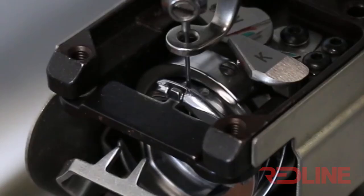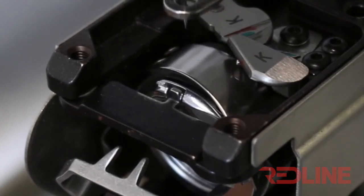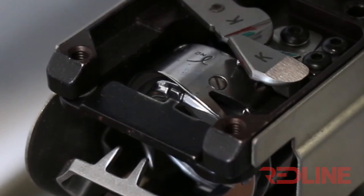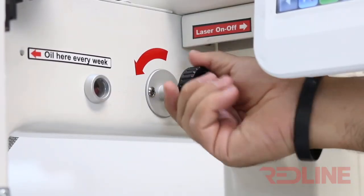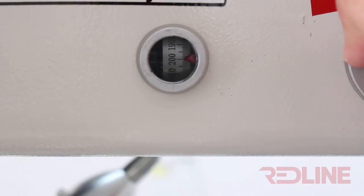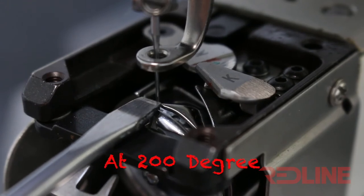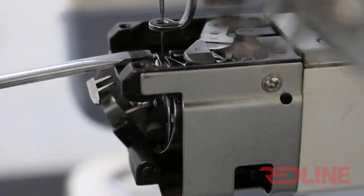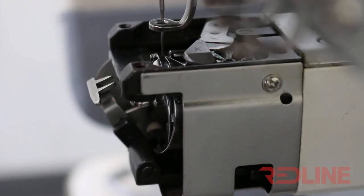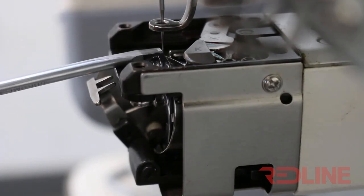This rotary hook is on timing and you can see how close the rotary hook passes by the needle. So if the rotary hook of your machine is out of timing, it will definitely break the needle. I will place a link in the description below on how to check the timing of your machine. Another possibility is that your rotary hook is on timing, but your needle is too close to the tip of the rotary hook. So at 200 degrees, use a flat screwdriver to push the needle to see if the needle has a little play. If the needle does not have any play and is touching the rotary hook, you must redo the timing.